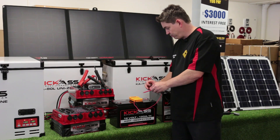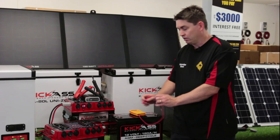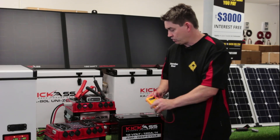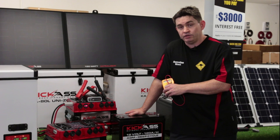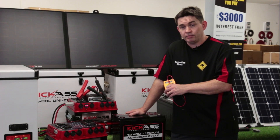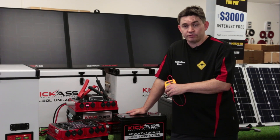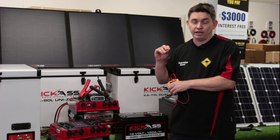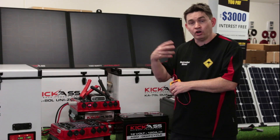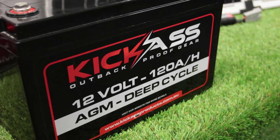We're going to set the multimeter up here and put red to positive on the battery and black to negative. That's a good charged AGM battery. You can have it up to about 12.8 volts with no load — that's a fully charged AGM battery. Now if it's lower than that, if it's down about 11.8 volts, I suggest you charge it and check the voltage after it's charged to see if it holds that charge. Once you charge it, it really has to stay at 12.8 volts. If you go back overnight and check it again and it's still 12.8 volts, then great — your battery appears to be in operating condition.